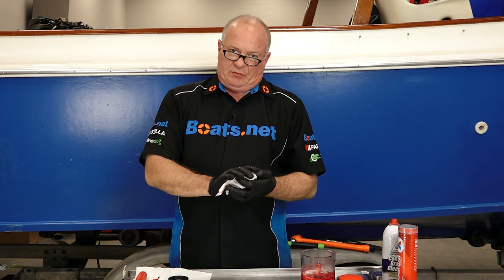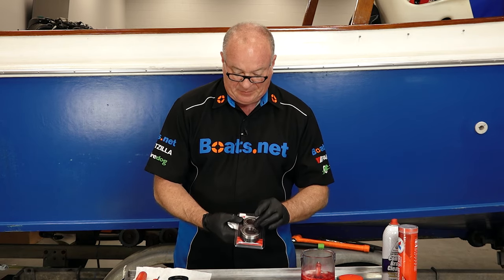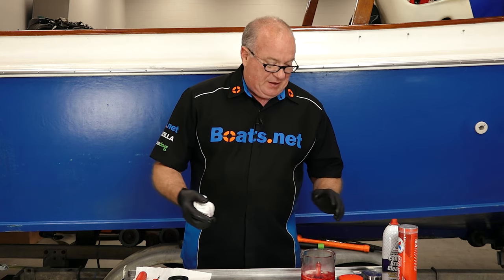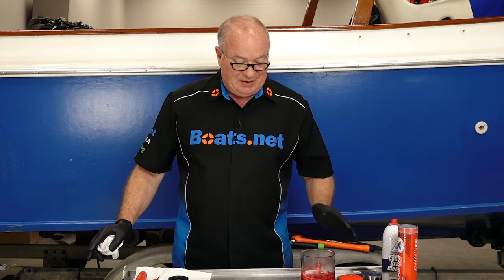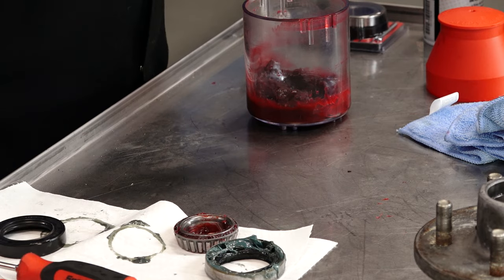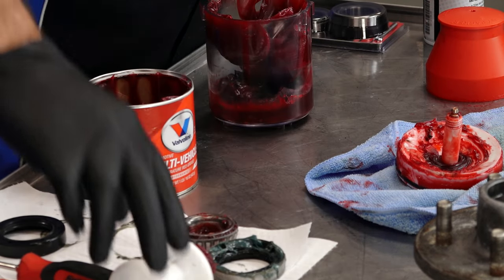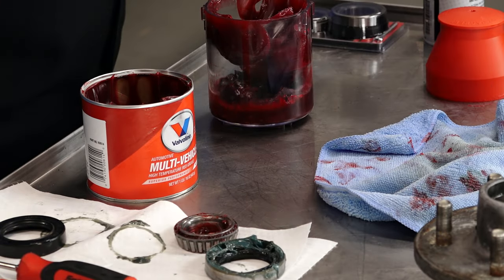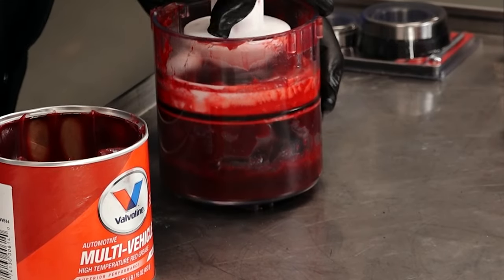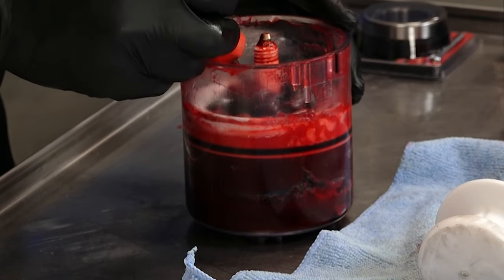If you were having to replace your bearings, it's especially important to use a packing system to force out any air and then force grease into all those different areas of the bearing itself. Otherwise you put it in there dry and may just have some grease on the outside — the bearing is not going to last as long as it should unless it's completely packed full of grease, which is what this accomplishes. My grease of choice is this red stuff — super sticky, lasts a long time. The grade one more time is GC-LB; that is what you're after. It's a very messy procedure, but I'd much rather do this now than be stuck on the side of the road with a burned out bearing or a wheel headed off into the unknown.